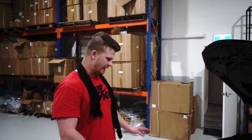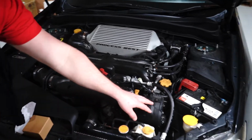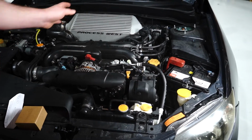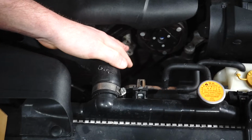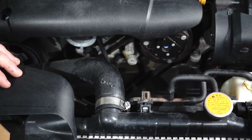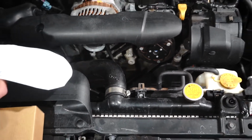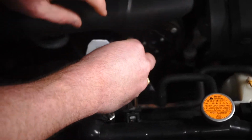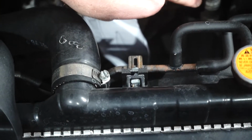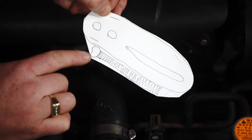Okay, so we're here working on a 2010 WRX, but basically all the EJ engines are the same, but the accessories around them change. So you might be working on a different type of car. Some of the panels and perhaps this vacuum solenoid here might look different, but the one thing that remains the same is that just here you'll have the little tensioner bracket. Now we don't, because someone's done a delete in the past, because theoretically if you get the fan belt the correct size, you don't actually need it. But most likely you will have a bracket. That is what it looks like, but obviously there'll be a pulley here, and it just sits down in here, right on that aluminium thing where I was pointing, and it's two 14mm bolts, and then the pulley moves up and down with this 14mm adjustment bolt.